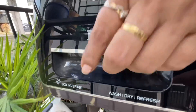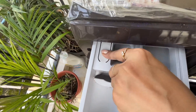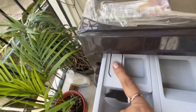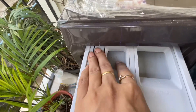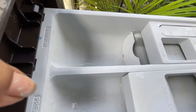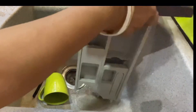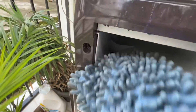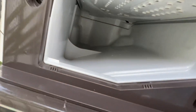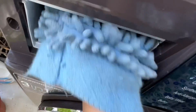The next step is to clean the detergent tray where we put washing powder or liquid. I used the cleaning powder in this tray as well. This tray was already partly cleaned, but I pressed the release button and removed the tray completely. Then I washed the tray and put it back. In the last step, I selected the rinse cycle and pressed start. This will wash the machine with plain water. That was the full process of deep cleaning the washing machine.